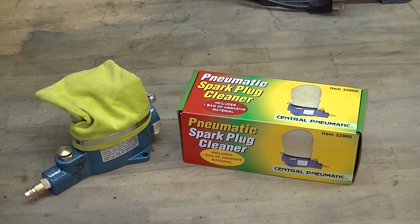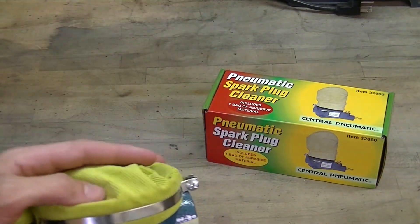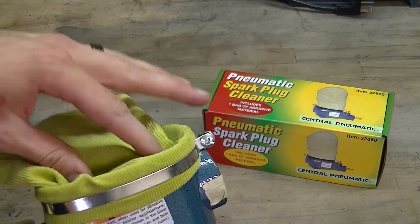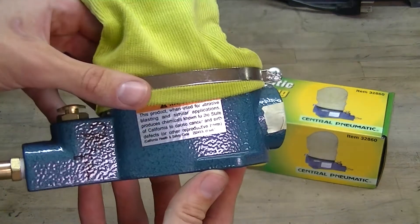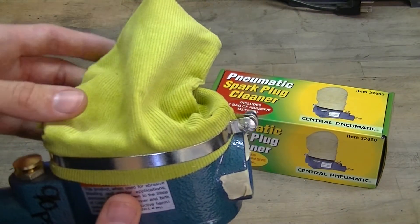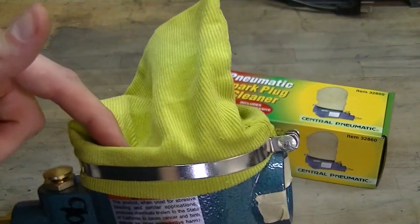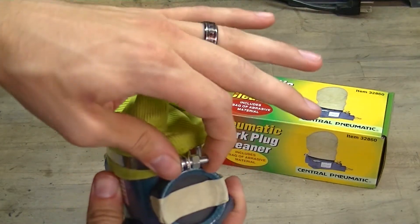It's so easy to rack up money constantly changing out spark plugs if you're fouling them real quick or you have some other issues. So we're gonna go ahead and actually give this thing a shot. I've actually gone ahead and already opened it up — I should have filmed a video of me opening it just so you guys can see what it looks like when it comes in, but feel free to look at it for yourself. Obviously the directions are really simple. This bag is not attached when it first arrives — it's just an open chamber. It's got two sides and the directions tell you what you need to do to assemble it. The way this thing actually works is it's essentially like a little mini sandblast cabinet, so you actually will put in a blast media that goes into this chamber. It is supplied in a bag — it only comes in a little container, so you'll definitely want to probably pick up the extra container that you can purchase alongside of it, just because you're gonna go through it pretty quick. So you put the blast media into the chamber, the directions again show you what you need to do, you slip the bag over the top, wrap the band that is included around it, and then tighten it down.